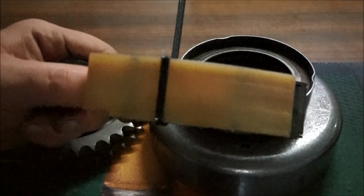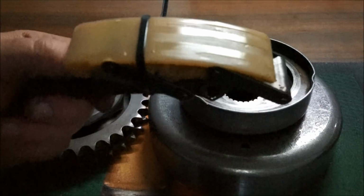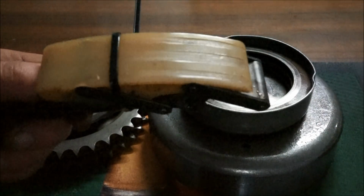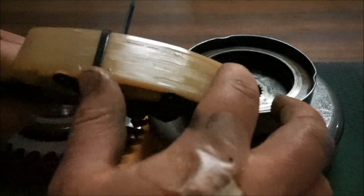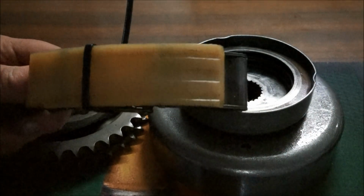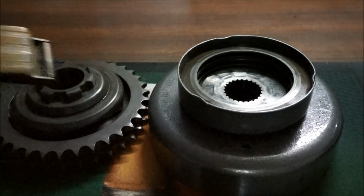If you have a look at this, the chain tensioner, it's got some pretty big cuts in them. It's done 40,000. You got to expect that, but so I went with the manual tensioner. Hopefully I've got it set right. So yeah, I'll basically just throw that one out, but pretty good to see and compare the two. The camera probably doesn't show it up that much, how big these grooves actually are, but I think they're pretty significantly big, so cool.